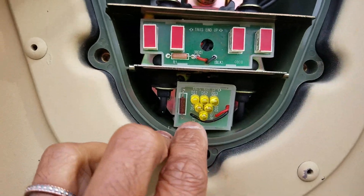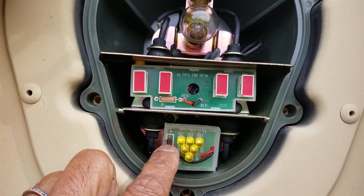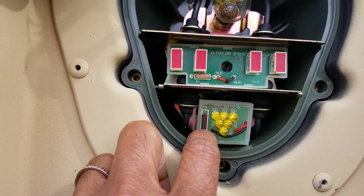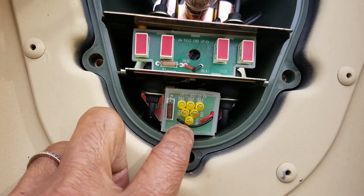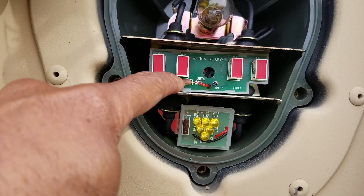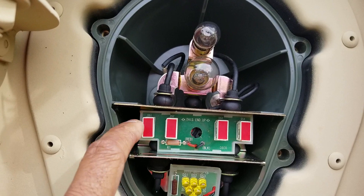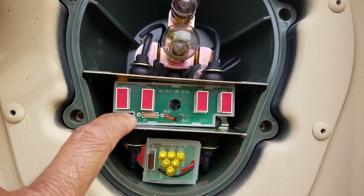Just quickly walking through — these are LEDs, and these work on 12 volts. I think they might work just a little bit dimmer. I might end up changing the resistor at some point in time, but I think they should work as-is with 12 volt. Same thing with these — you could end up changing the resistor value to match the 12-volt input to make them look brighter.